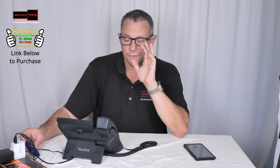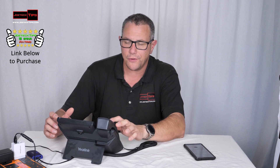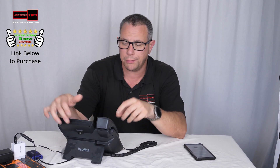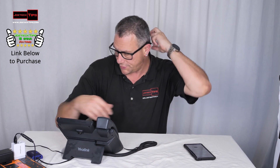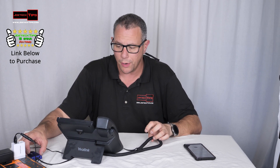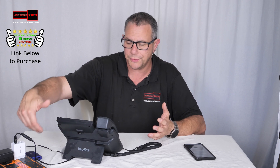The functionality of this is incredible. Having the ability to have a VoIP phone wireless is great. The larger, more expensive phones have a Yealink Wi-Fi dongle that plugs into the USB port — however, then you lose your USB port on the phone, so that's the only drawback to that option. This dongle goes directly into the RJ45 port, yet you still have the ability to plug in a USB drive to record phone calls. That's why I like this scenario better than the other.